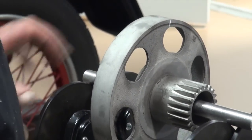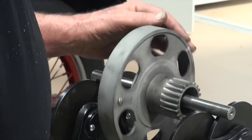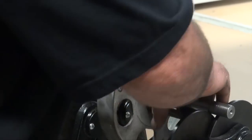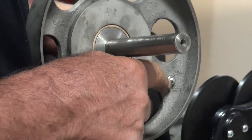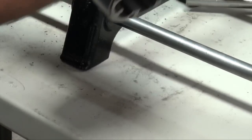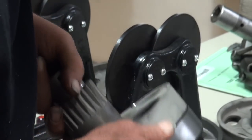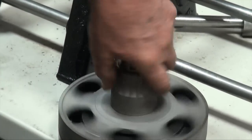We're pretty happy. We've got a reasonable gear and fairly nice low speed surface on it, so we'll probably be happy here. You can see the screw is extending through, but that doesn't cause an issue because this piece goes up onto the brake drum. If I drop it down — you can't see in there with the camera too good — but there's a good quarter inch plus clearance between the brake drum and the low speed drum, so it doesn't hit and doesn't do any interference.